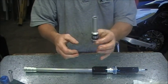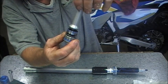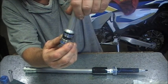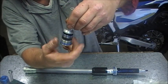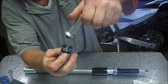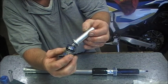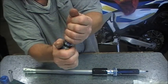Now I'm going to show you why you shouldn't rattle out that base valve. This is why — that is now loose and almost off. When you use a rattle gun, this undoes, but because of its inertia, its weight stays put and basically you also undo that at the same time. Good idea to put that back together with a clean-up and a little bit of Loctite. That's what most guys do anyway when you put these things back together. That's why rattling does that.